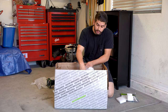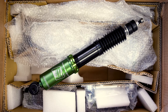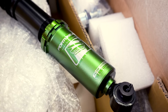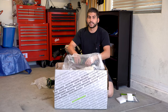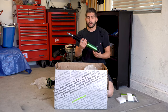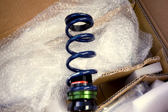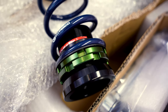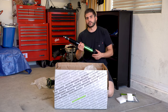With the backs, we're actually going to have a little bit of a different setup — the shock is actually going to be separate from the spring. The Mustangs, at least in this generation, the S197, run a divorced rear setup where the spring is sitting on the chassis and the shock is separate from the actual spring. The rears are just the shock, but you still have adjustable ride height on the spring and spring perch, and you match the shock to whatever ride height you want. We'll talk more about that during the actual installation.